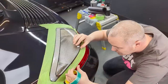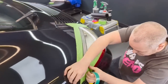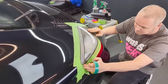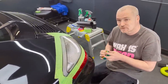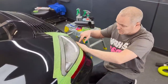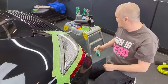All I'm going to do is follow the black swage line. You cut by going underneath the film and cutting away from the car with the wire, rather than cutting from the top down with a scalpel, which sometimes you have to do. But when you don't have to, it's best not to. So what we've done here is we've got a perfect line. The film will go over there, and once we've laid that on, you pull it through and it cuts through it. It's clever stuff, really.